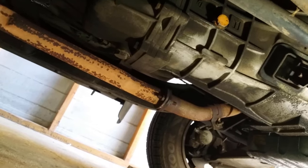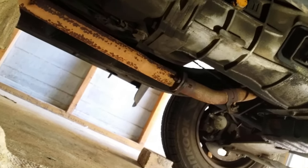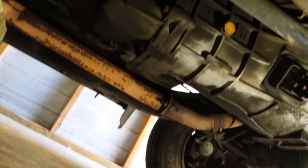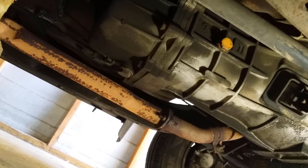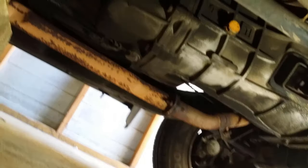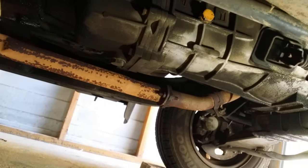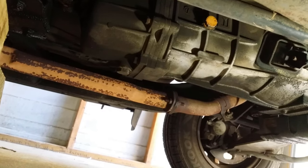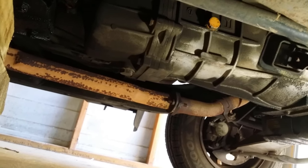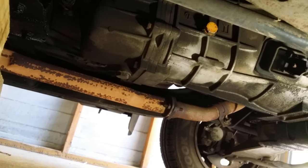Probably just because of heat and time, maybe the aluminium changed its form — I don't know. But that's what I'm dealt with. The last oil change I used 140 viscosity oil, and I found that was hard to shift from first to second before the oil warmed up. After that it was fine. I'll drain the oil now.